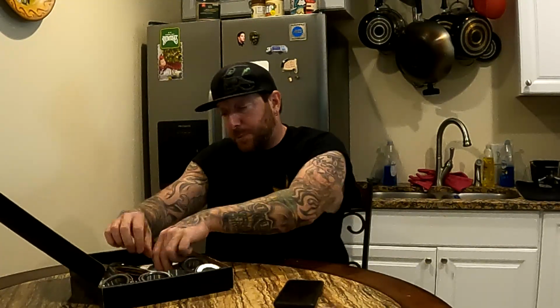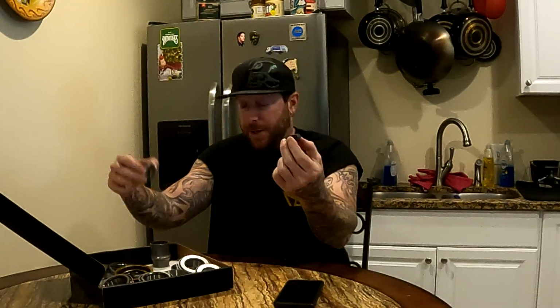It gives you your gasket, which I don't use, but some people use them. It gives you your inner and outer pinion bearings and the races. Gives you both your carrier housing, your posi unit bearings and races for the sides. Gives you a whole pack of pinion shims, a whole pack of shims to set your backlash for the posi unit. Gives you your seal, gives you marking compound to check it when you're done. Gives you a new nut for the pinion yoke, new washer, and a new crush collar.